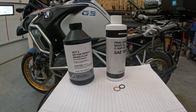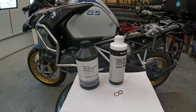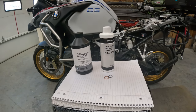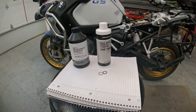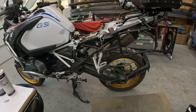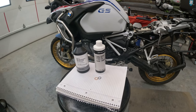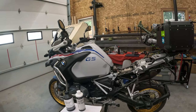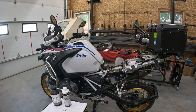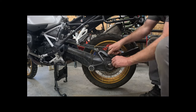All we've got left to do is install new brake fluid. BMW asks that you put new brake fluid in one year after the vehicle was made. This is a 2022 but it is one year old in June, so it's about a month or two overdue. You've got your final drive oil — one of the coolest things about this bike is that shaft drive. You only have to change the gear oil every 12,000 miles on that single swing arm rear shaft drive, versus a chain bike where you've got to do it much more frequently. Let's knock those two things out and reset the computer. We'll take it to Missoula BMW for a valve clearance check and we are done with this 12,000 mile service.